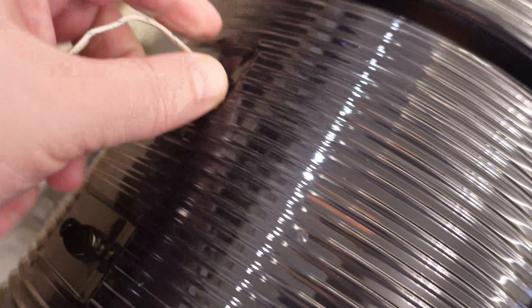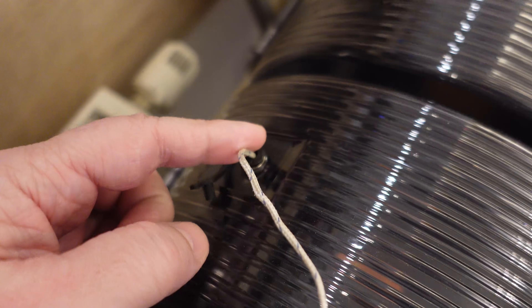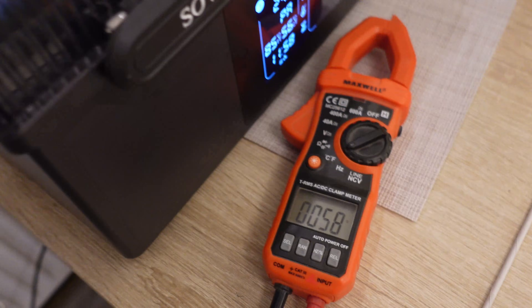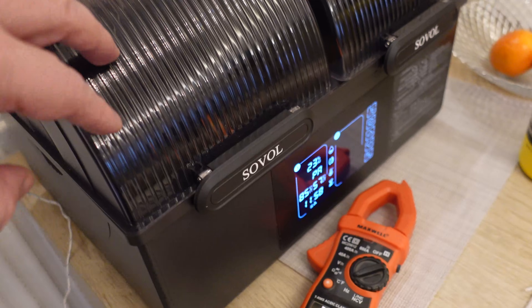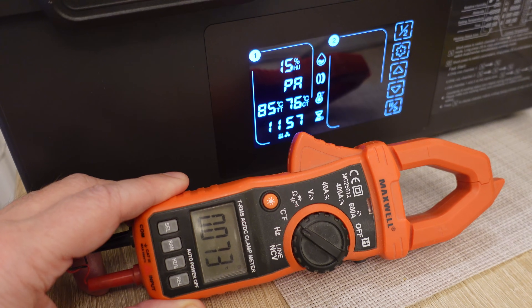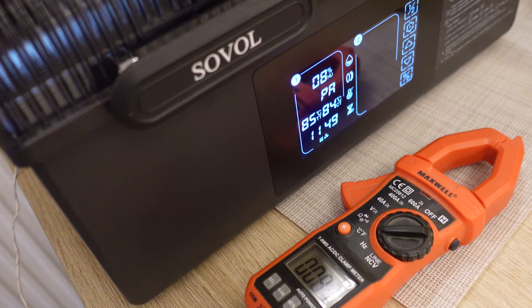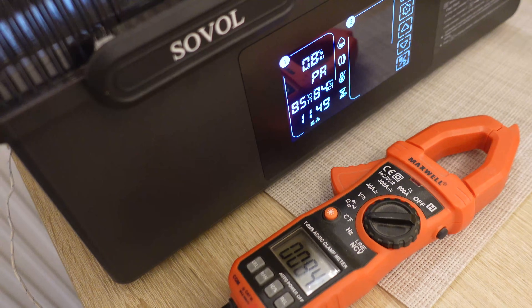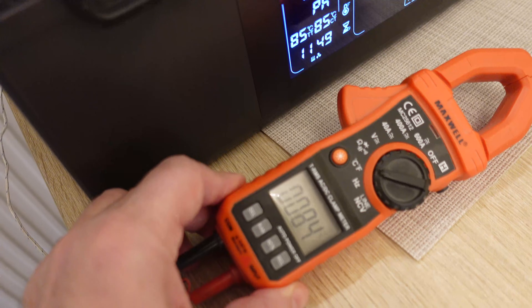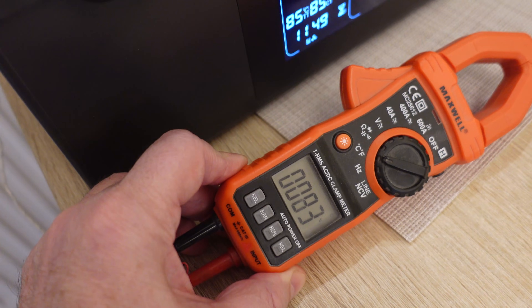The sponge drying test became less useful at these temperatures because even after 30 minutes it was completely dried. I do have a temperature-only sensor that fits through the hole, so I can completely close the lid this time. Set to 85 degrees Celsius, the temperature immediately started rising. After 10 minutes, the temperature inside is already 84-85 degrees Celsius according to the dryer's own sensor, and according to mine it oscillates between 80 and 84 degrees. These two sensors are now showing very similar temperatures with the lid fully closed.